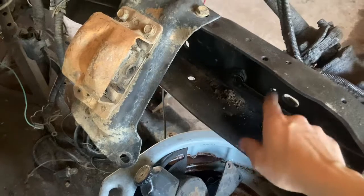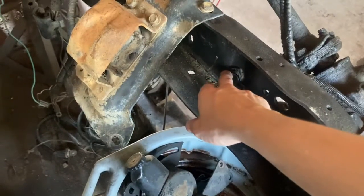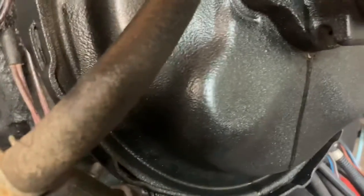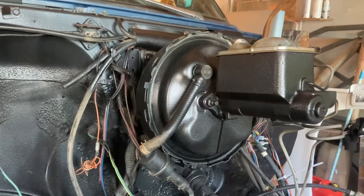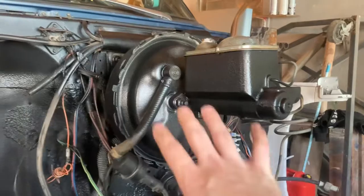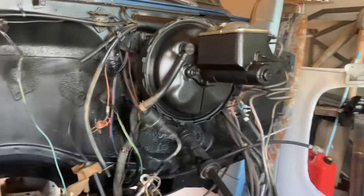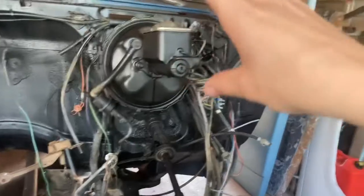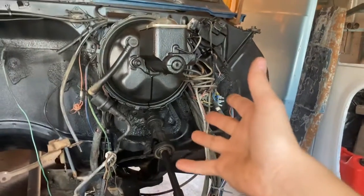I'm taking out the brake lines because the cross member can't go any farther forward — without that it kind of hits here, and I need it to go forward. So I'm going to take the two-wheel drive brake lines out. As you can see, the brakes are leaking anyways — this is why I like painting things, it shows you where things are leaking. I'll probably have to put some new gaskets in there. Not surprised — it's a 40-year-old truck that's been sitting out in the sun with no hood on it, in the elements for two and a half years. I'll probably do that when I do the pedal assembly, because I think to take this out I've got to take the pedal assembly apart to swap it and add the clutch pedal.